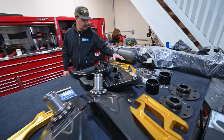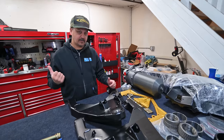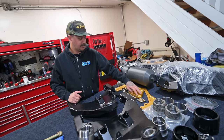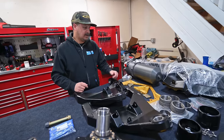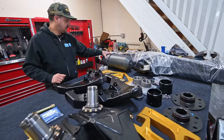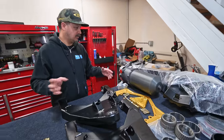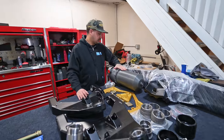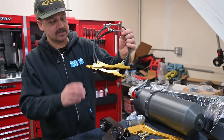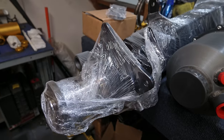We got the mid-plate and front motor mounts here. It's running ID Designs pre-runner accessory drive on the LSX 454 — I'll show you the engine in a sec. We did these billet mounts that bolt to the chassis and tie into the ID Designs front plate. Got some bearings and stuff ready for the hubs over there. Dry sump tank from Era One — we took this apart and got it all hard anodized. Basically all the parts, I didn't want anything to just go in raw. Even the dry sump tank straps — took those apart, got the brackets anodized, just to clean things up and add that little bit of detail.